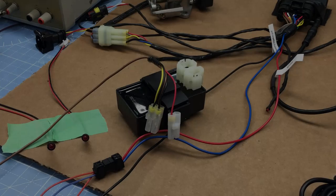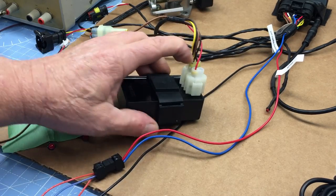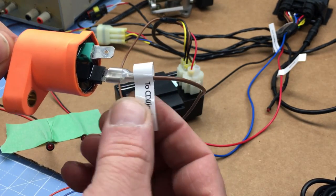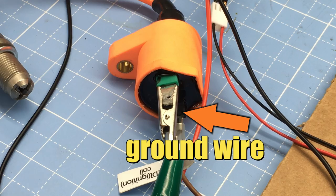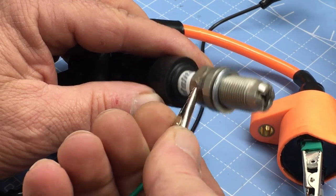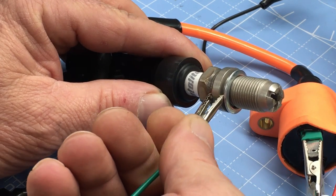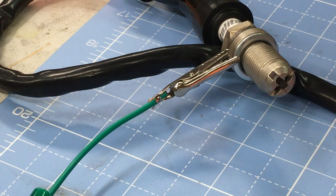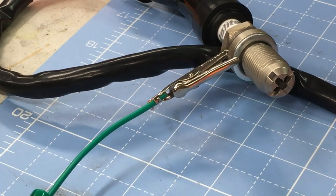Let's take it to the next level and test the ignition system. This system uses a GY6-type CDI ignition module — I'm not sure if it's a true GY6 or a custom unit, but the vendor showed a GY6 ignition coil on their eBay page so that's what we're using. The green post on the coil needs to be connected directly to ground to provide a return path for the high voltage, and the spark plug also needs to be connected to ground. The ignition system generates high voltage — generally not enough to seriously harm you but it will sting — so use reasonable caution. Let's do the magnet trick again and see if we can get spark on the plug — and that's pretty cool, and I didn't even get zapped.